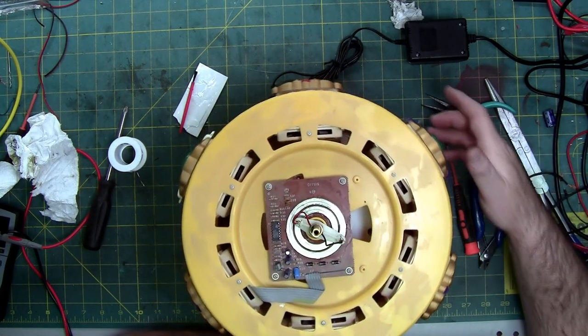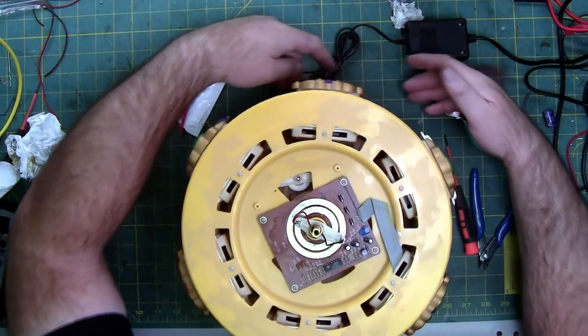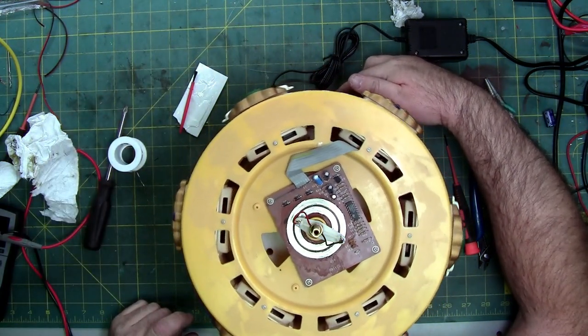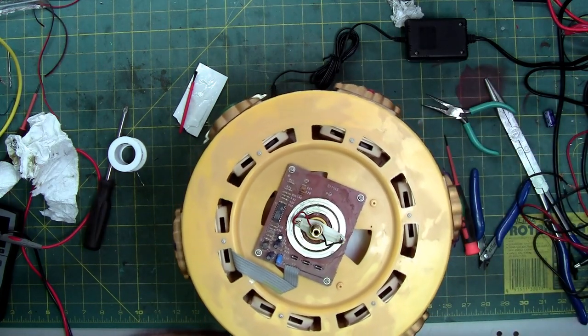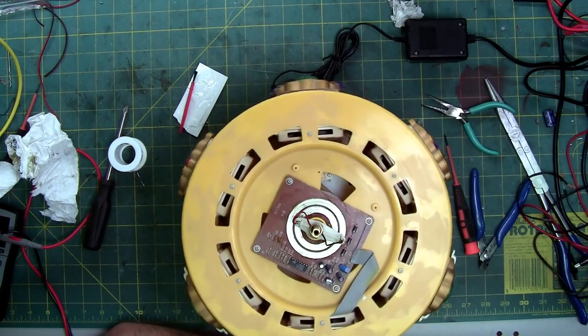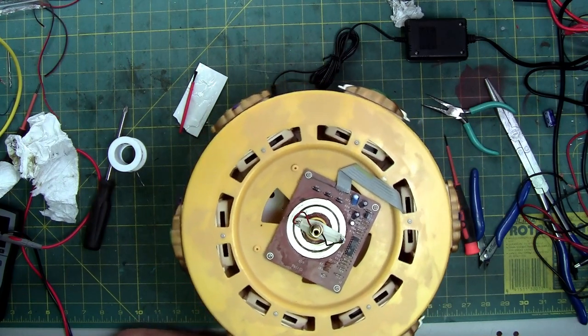Now we're sliding the rotor assembly back on. These are keyed as well for the wires. To keep tension on it we need to put the nut on, put the wires in their respective grooves, and tighten it down. All the horses are working, though still having some intermittent problems. I'm watching the rotor because it's not flat — it goes up and down — but I'm checking the contacts to see if they're lifting. I also rotated the spring pins, because the flat sharp end of the spring metal may have been preventing even tension. Once I rotated them, they're working fine.